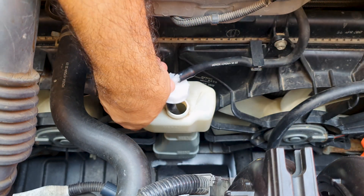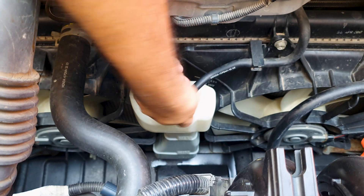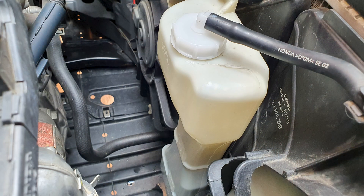Just put this cap back and do not over-tighten it — over-tightening will not stop the coolant from evaporating. Just snug it tight. That concludes the video. You've seen the consequence of overfilling coolant, and this was really the best possible outcome — having only a cracked cap that cost less than a dollar. As always, thanks for watching.